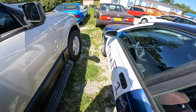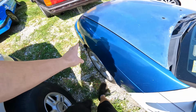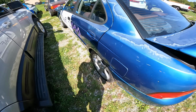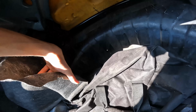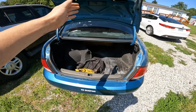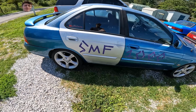Okay, so it's definitely a lot more tail happy than it was. Some more stuff that I did was add front wheel spacers, 1-inch wheel spacers on the front and none at the rear. I also pumped the rears up to 45 PSI, and I added this rear strut tower brace. Again, all of this stuff is to just try to make it slide around more. And we definitely did that. I wish it was even still a little bit looser than it is.